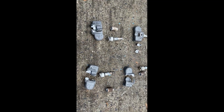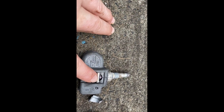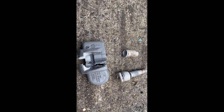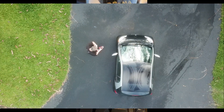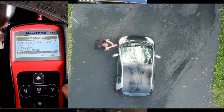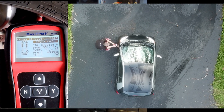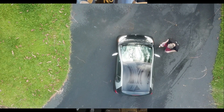Here are the TPMS tire sensors when I took them out. All of them broke — well, that one was intact, but the nut broke on that one. You can see they broke because of trying to torque it off; it twisted and broke the plastic. So when you take yours out, expect to have them damaged coming out. All the sensors replaced — put air in the tires, put the tires back on the car. Now we're going to test each individual tire and sensor, just to make sure — a sanity check — that everything is working fine up to this point.